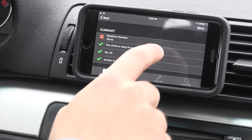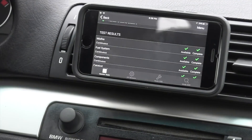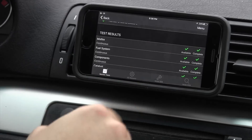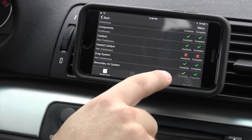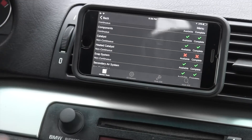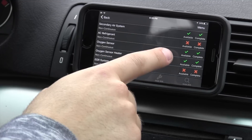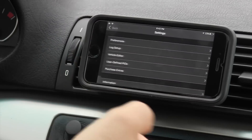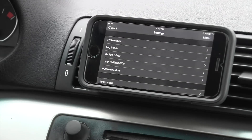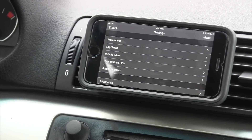It's giving me two categories: available and complete. At the bottom, my heated catalyst sensor — it can't read that sensor, I don't have it, so it's not available and therefore not complete. What you don't want to see is a sensor marked available with an X for complete — that would be bad. Back on the main page under Settings you have a lot of options.